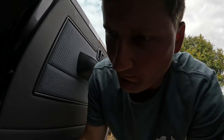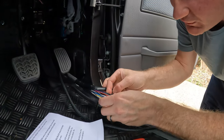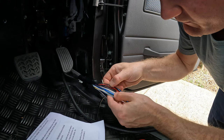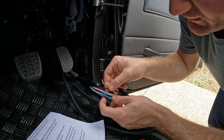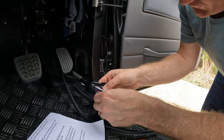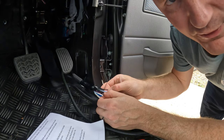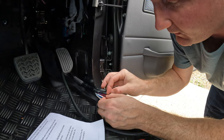I just worked out which one it is. Pull all your wires out and look - there are a fair few black wires in here. There are three really small ones, one really large one, and then there's a medium sized one. You want the one in the middle - that's the one you want for your reverse signal. It's a constant 12 volt signal once it's in reverse. Now I'm going to go through and quickly tape up all these ones - I just took a nick off the insulation to do a voltage check, so I'll fix them all up and make them look okay again.